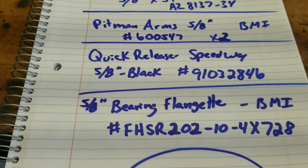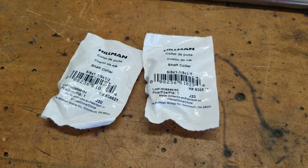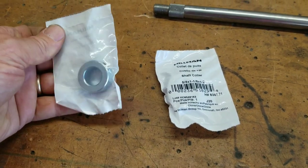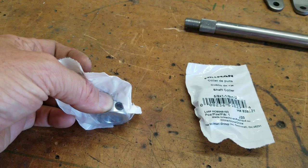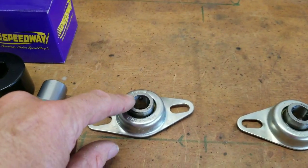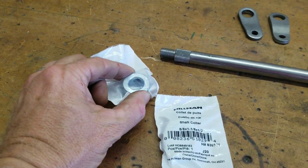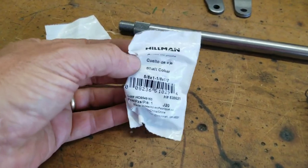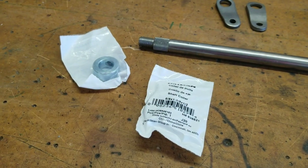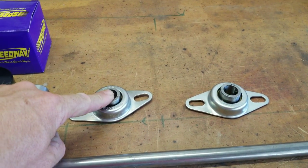This is part 10 of the chassis build. Almost forgot these — these are little locking collars. They have an Allen wrench bolt on them, and these go on the top and bottom to keep the shaft from sliding up and down. We put these on here just to give extra protection so that your column doesn't slide in or out as you're driving. These are the part numbers; I got these at Ace, about $3 or so each. We'll put one at the top, one at the bottom, in front or behind these bearing flangettes.